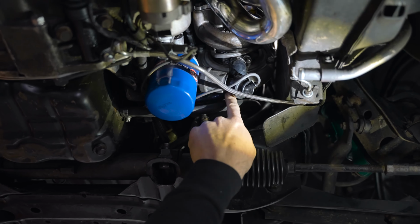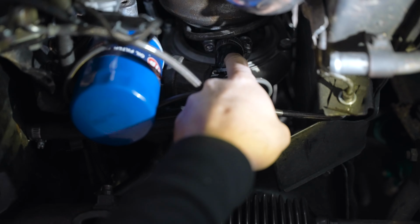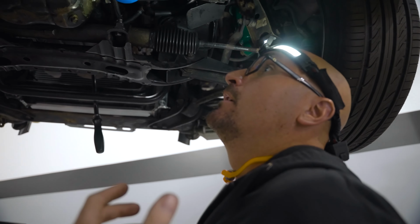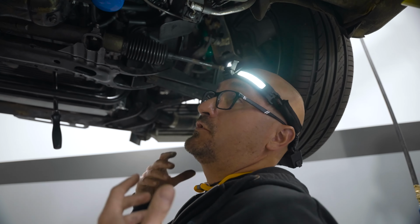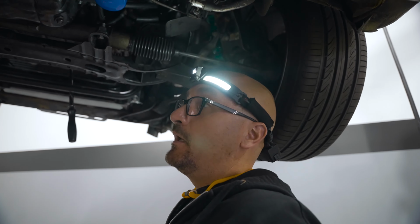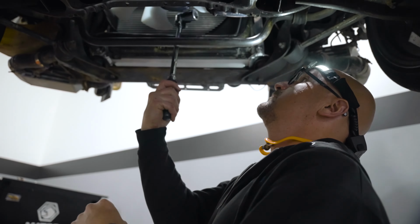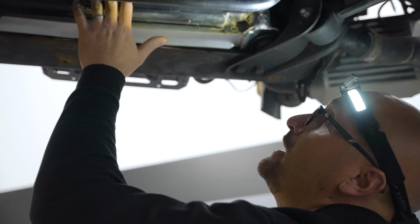This oil drain hose will definitely need to get fixed. It's just up against this oil pressure sensor, and we don't want that. You don't want any of these lines to be kinked for the oil drain. It could bring up smoking issues with the turbo, and it won't drain back, so the oil just backs up into the center section, and you'll start getting smoking. Either it'll come out through the exhaust, and if it doesn't come out of the exhaust in smoke form, it can actually get into the intake side, and you get oil getting into the inlet of all that stuff. So, line up to put this thing on TDC, and it's just missing the lower radiator fan shroud.